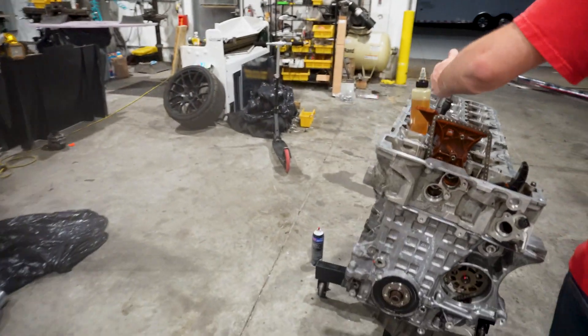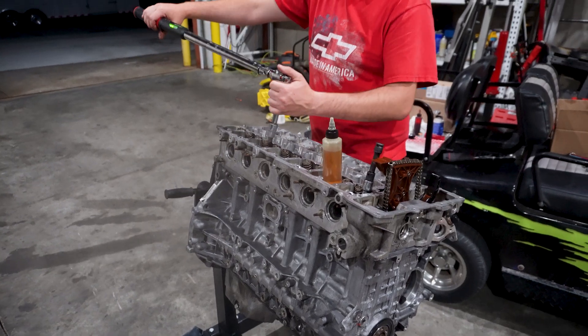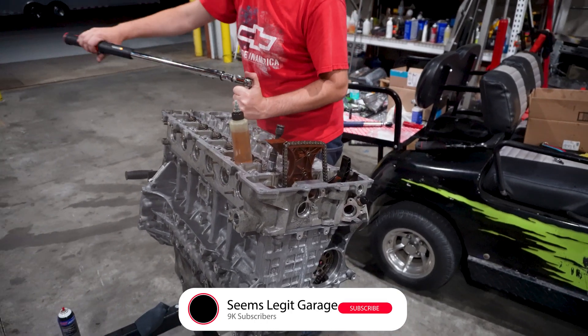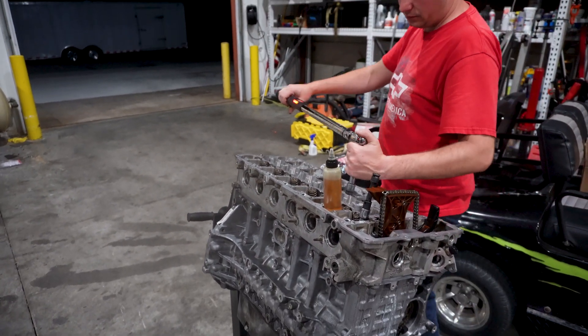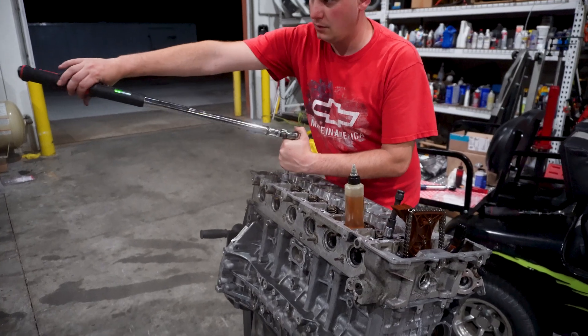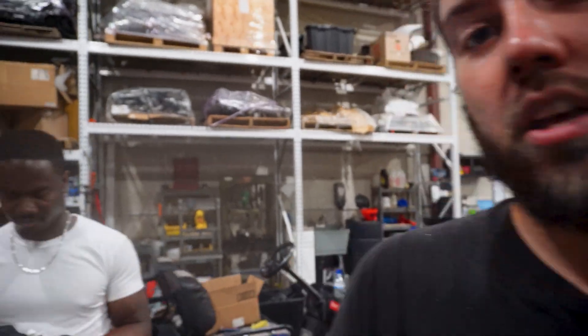We're special - it's in the 1M. I don't know why they put a T on it. So we just did the head studs and let me tell you, it was pretty gnarly. It's only like 100 and something foot-pounds at the end, but it's like 30 newton meters, 90 degrees, then another 90 degrees, then 45 degrees. So we had the 6-foot bar out, and I literally thought I was going to break them all, but we managed.